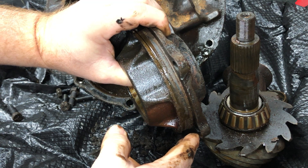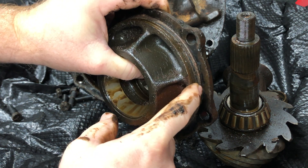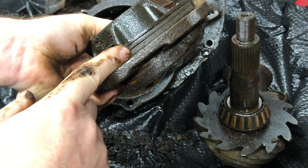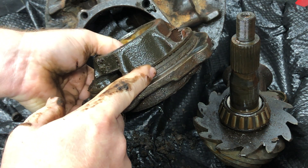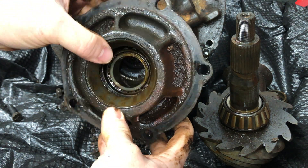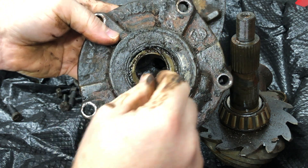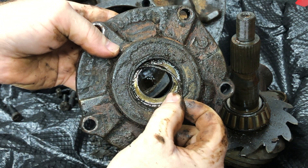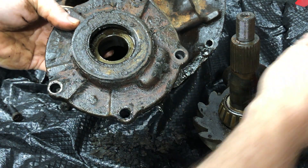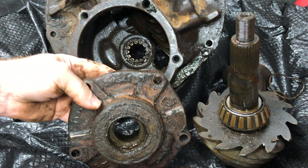Here I show the o-ring on the pinion support — it was flattened all the way down, and when I removed it, it literally looked square instead of round. And as you can see here, the seal was literally just coming apart, pieces were coming out.